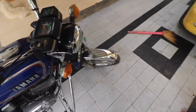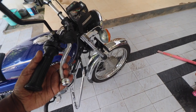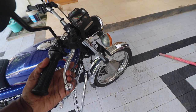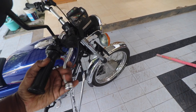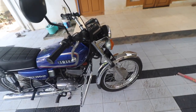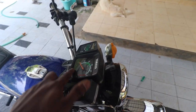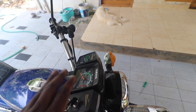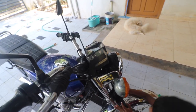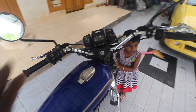Next, look at the front brake: rotate the wheel, apply the brakes, and see if the wheel stops. Also notice that the play should not be more than five to six millimeters — it should stop somewhere before the full range of travel, which means you have enough meat on the brake shoes. While rotating the wheel, also look at the meter and see if it is moving — it should slightly move, which means the meter is working fine and you don't have to spend money there.